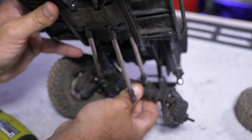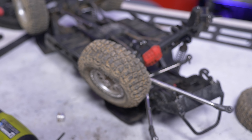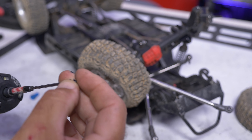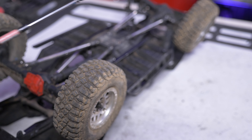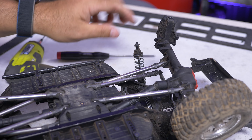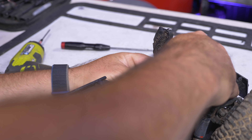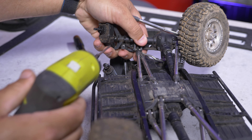They give you two included screws that you'll use to cinch it on. The first one is just going to go right through this main support and into the bracket. I'm going to put some thread lock on that one — it's not going through plastic. I probably could have put thread lock into the other end of the bracket before I put it on, but I did not. It's also going to thread into plastic so it should be all right. There it is, cinched it down. Now the last part is to reattach the panhard and put it all back together. Just getting this track bar to line up is the tricky part.